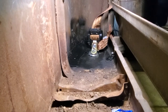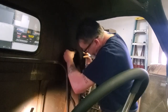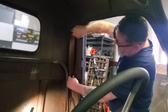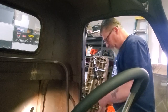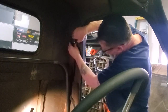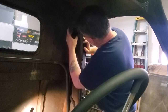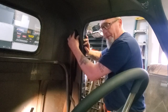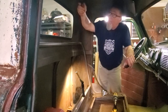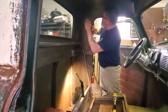I'm going to turn this just a little bit and run up top to make sure we're still on the right orientation — there we go, that'll be nice. This will get adjusted all the way up. Now we've got to get the shoulder mount mounted up at the headliner — that's gonna be the tricky part. First thing is to pull out the screws on this rail and remove that section of headliner so we can get to either side of it.